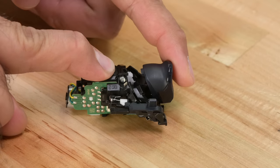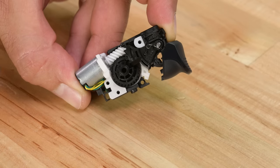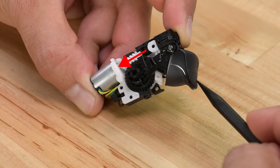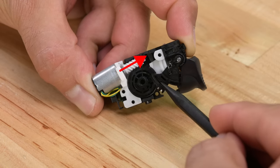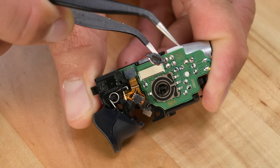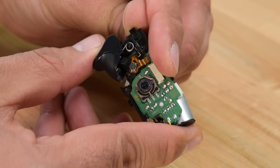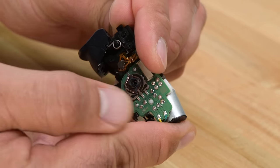While we're digging into the components of the controller, let's take a look at the adaptive trigger assembly. You can actually see how the adaptive trigger works here. Pulling the trigger will turn this worm gear, which in turn is attached to a motor. When the motor is powered, you're fighting an opposing force from the motor, which gives you that tension in the trigger. The second thing that stands out is the potentiometer that reads the position of the adaptive trigger motor. I'd be happier to see Hall Effect sensors here, but the use case also does seem to be appropriate, given the limited number of failures reported. Let us know if you've run into issues with the adaptive trigger in the comments below.